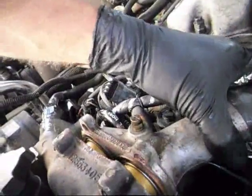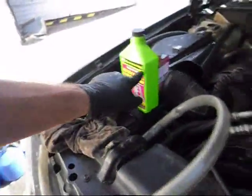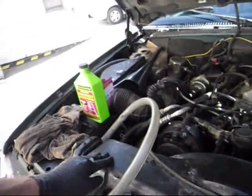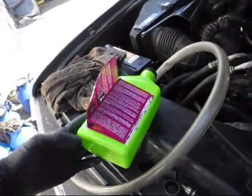Crack that off — things are in the way — then you've got to remove the thermostat. Then you have to mix one quart of this, a liter of this, and three quarts of water. Add it to the cooling system. Let it run for 20 minutes at idle — no revving, no driving. Drain it, flush it. Fill with antifreeze after you let it dry for 12 hours.